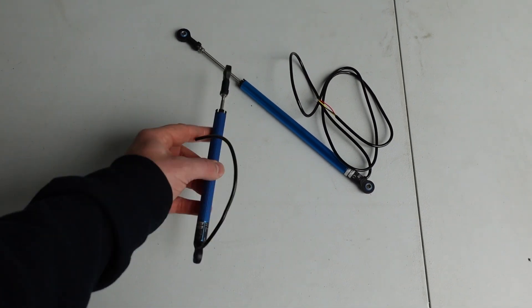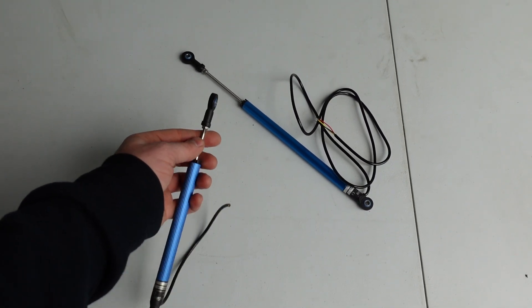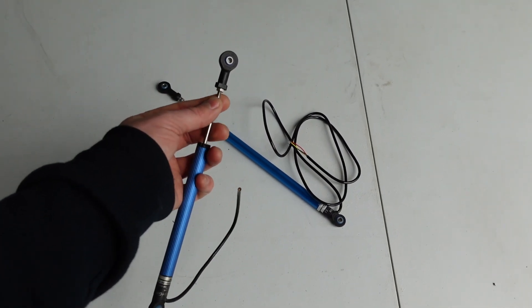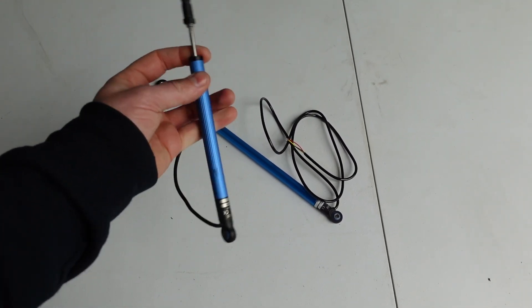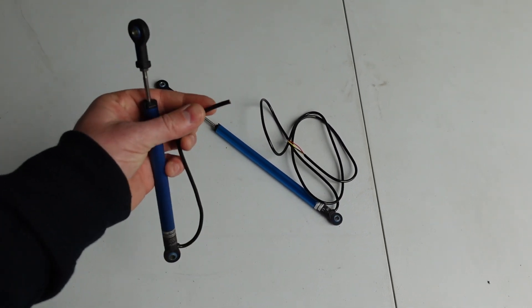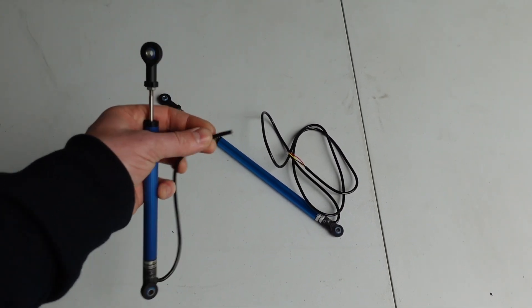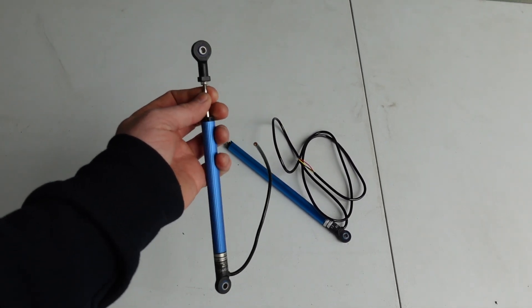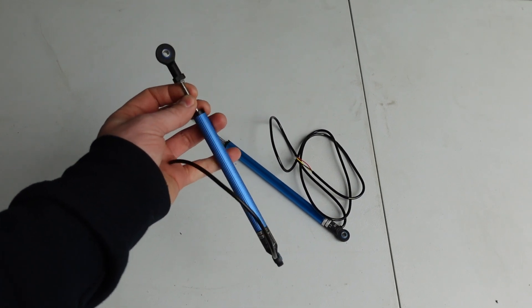This is an example of two different sizes of damper pot, both linear potentiometers. This is where you've got one end which moves inside of this housing, and there is an output here that would be run to your logger to spit out a position at each point the logger is measuring the signal in time.